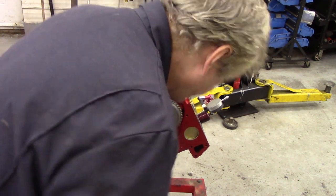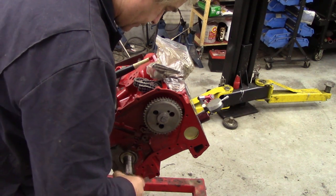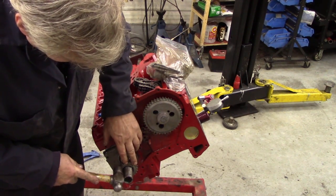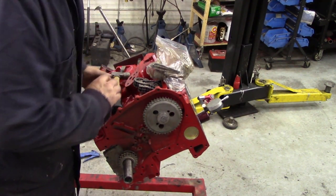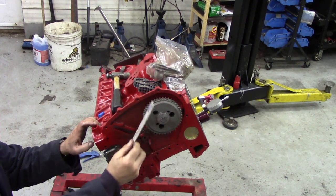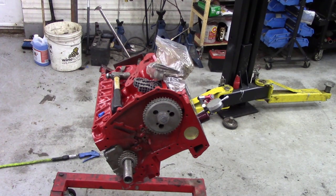So we're going to take the pulley off, put it on the floor, and put the sprocket on. Always check the teeth — make sure the chain wheel isn't hooked. We shall find out alignment with a straight edge — I'm going to use the high-precision Britpart ruler. Make sure the cam's pushed back. Put it tooth to tooth — that's good. It's got a step on here; the larger step goes towards the back, otherwise we'd be cock-eyed. Happy with that.